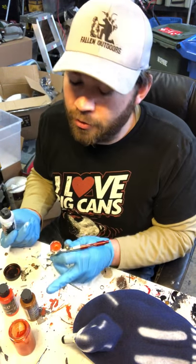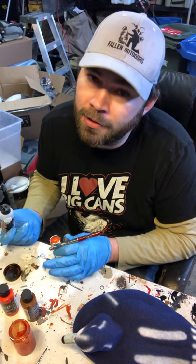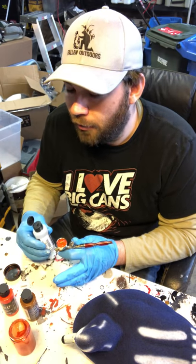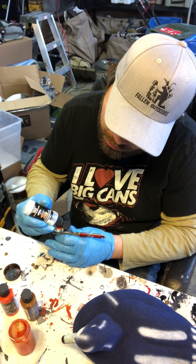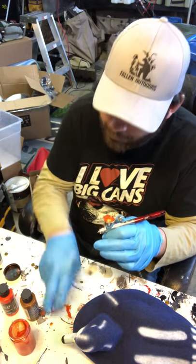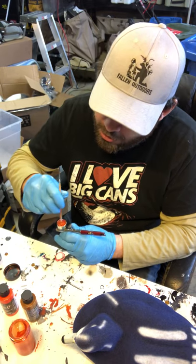The reason I don't pre-mix the reducer — like I talked about in the second video — is that the paint's going to change depending on temperature. Right now it's cold so it's thick; if I mix it when it's cold it's going to be really thin come summertime. So I just mix it in the gun. I'll usually fill my paint cup about three-quarters full and do about six drops of reducer, then mix it up really good.